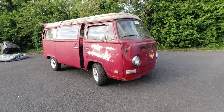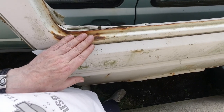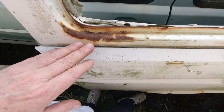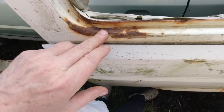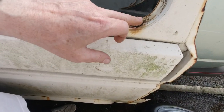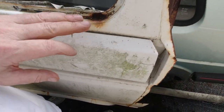I'll now go and show you some other repairs and stuff that you may come across, something like this, which I wouldn't be happy with. But here's a panel from the vanagon, guys, and again, look, there it is on the corners. It starts in the corners and it works its way along, right? These are good panels, but I'm just showing you where and how it starts, right? There's no point in showing you complete rust buckets just yet, but it starts at the corner, it works its way down. That's what you'd be looking for, right? Something that's just starting, which is a great thing to see, because at least you know, right? Some people will have a lot of stuff covered up and you won't know unless you bring that magnet with you, and you're buying Bondo, yeah? You're not actually buying metal. So it starts in the corners. This would be the rear quarter of a vanagon, okay?